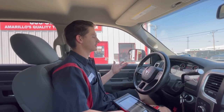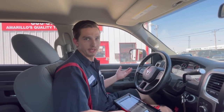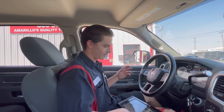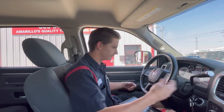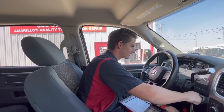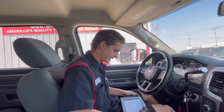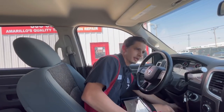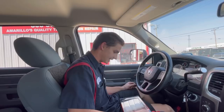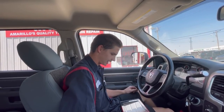That's how you do a quick learn. There's a little more to it — that's just the quick learn part. We still have to go drive this thing at a certain rate. We're going to turn it off, turn it back on to let it reset. We're leaving our scanner hooked up, though on some trucks a scanner can cause an issue, so sometimes you have to be careful.